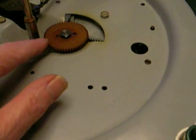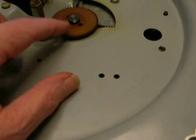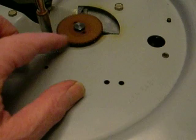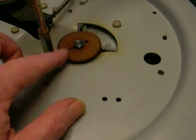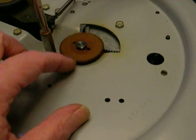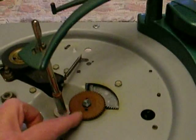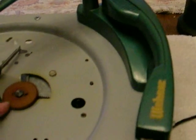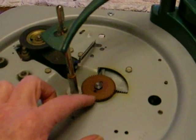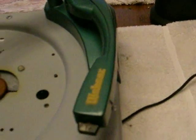The part I wanted to show you mostly was this fiber gear here. This rotates all the time — the turntable is rotating, it never stops. As long as the motor and turntable are going, this thing is moving. That's part of the velocity trip, and that's the characteristic of these things. If you have a Zenith, an older Zenith Cobra changer, it's the same thing — Webcor, Webster, Stromberg Carlson — a lot of companies used the Webcor changer. If it wasn't Webcor it was VM or Crescent, and sometimes Seeburg had a home changer, but mostly by about 1948 Seeburg was gone.